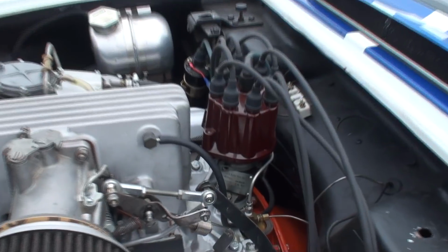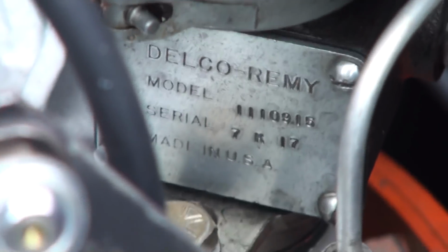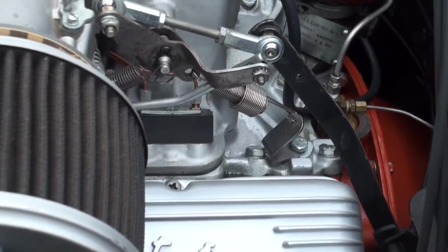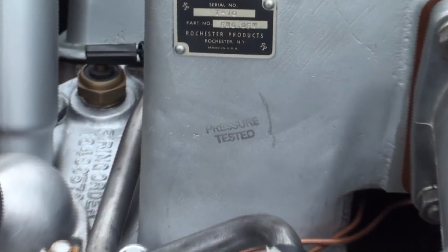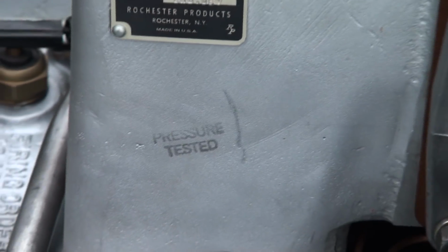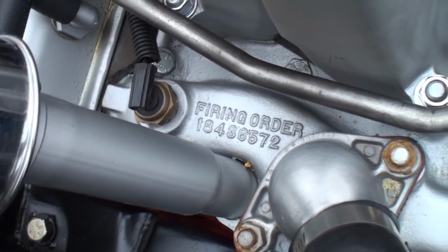I'm noticing that tag right there. That's that Bill Thomas plenum I told you about, the big finned aluminum thing. That's where the air goes in. That's strictly an air meter, and it mixes with the fuel down at the fuel injectors. Bill Thomas took these things and actually cut them in half and went in with a machine, the bottom of them, and radiused all the intakes. So it's a legal modification, but it has a lot of high-end horsepower.